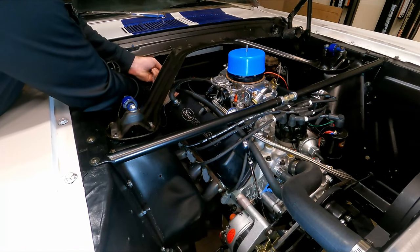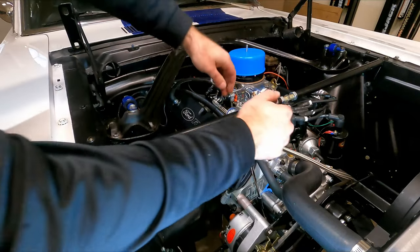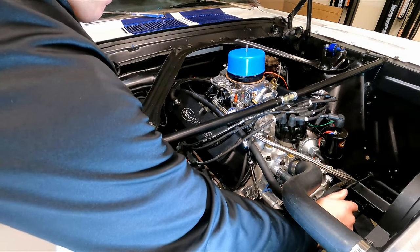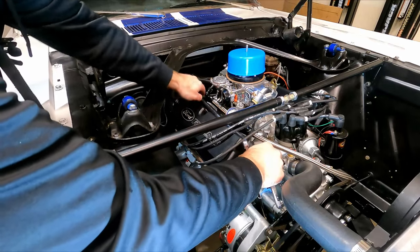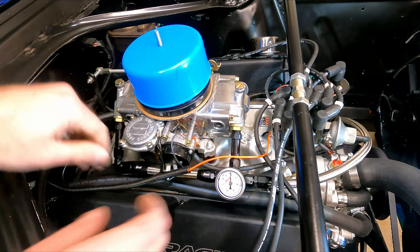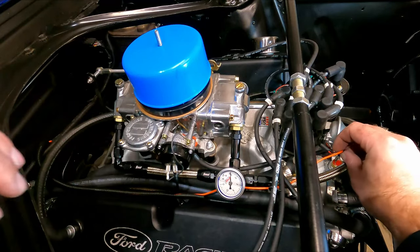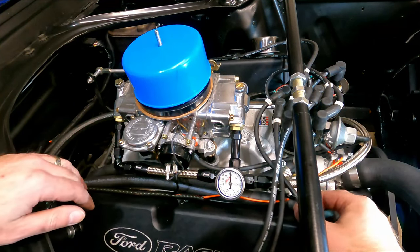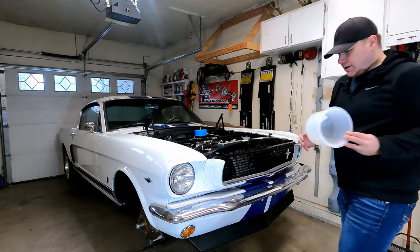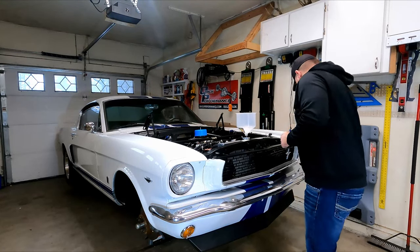Now I'm just going to go back and double-check all the clamps to make sure they're nice and tight because I don't want anything leaking again. Everything's snug, everything's in place — I think this counts as another win. We don't want to forget to hook up everything we disconnected. This is the choke wire, and this is the temperature wire for the fans. Now we're looking good. So now I need to just put the coolant back in the car. I can reuse the stuff I had because I don't even have any miles on this thing — just long enough to turn the car on and then I found that leak. So go ahead and put the coolant back in.